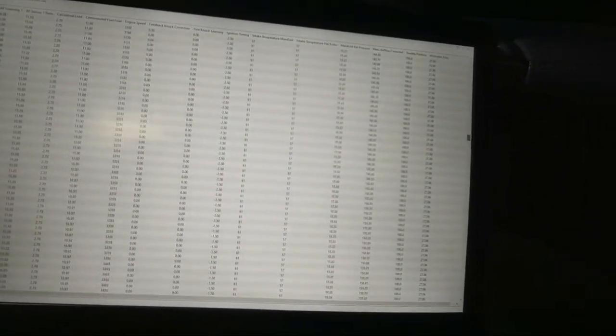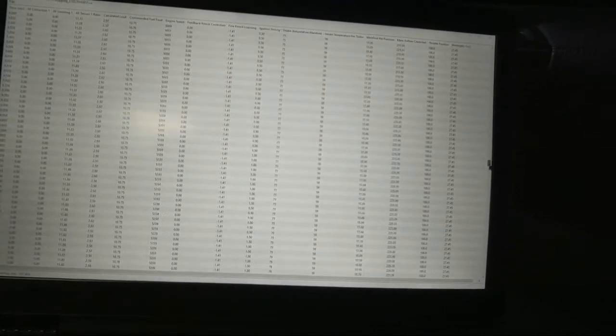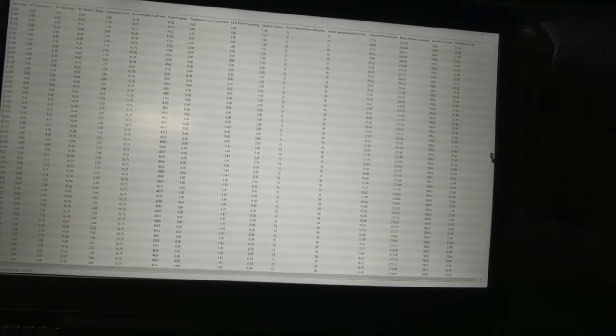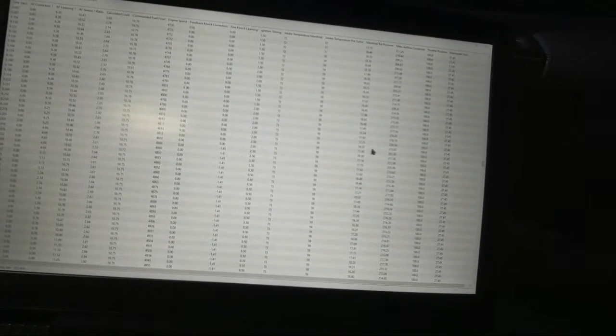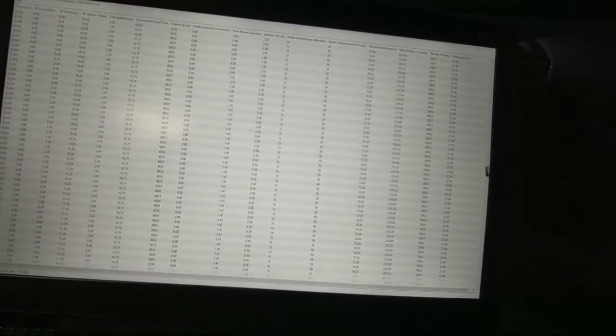So we're gonna go with this log here. Same deal. Starts off in the 60s. Timing's negative because that's what happens on these things when they hit boost. Starts coming in. There's a knock event that it has one. Well, it's a fine knock learned here at 48. Pressure is 18. Timing's only 2 degrees, 2.5 degrees, which doesn't seem too bad to me.